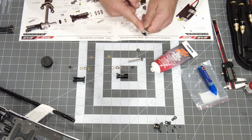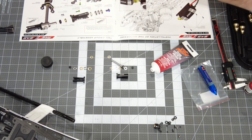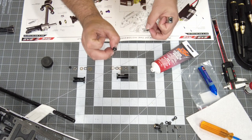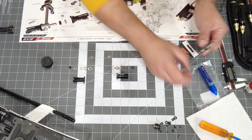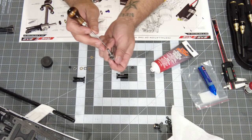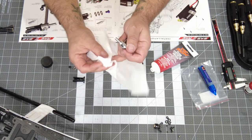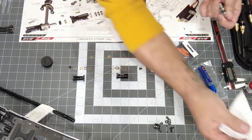I'm using my finger to smear some grease around in there so we get the back side of that dampener coated. It's not going to hurt anything if you get a little too much — it'll just work its way out. The reason I slide the dampeners on first is to clear some of the grease out of the hole. I don't want grease getting into the threads on the end of the tail shaft.